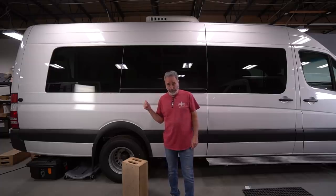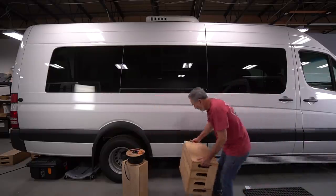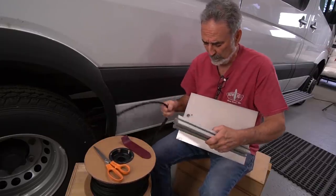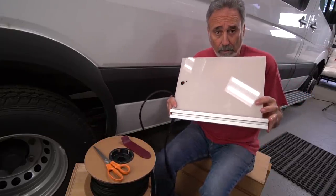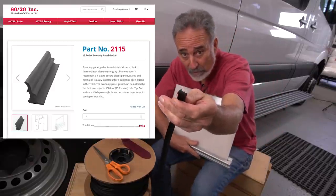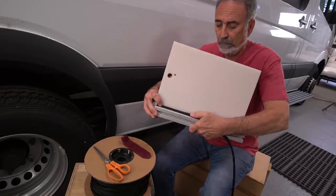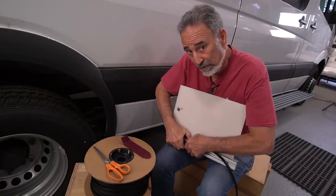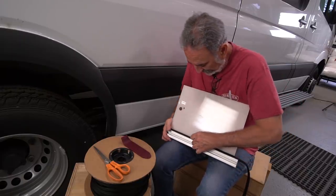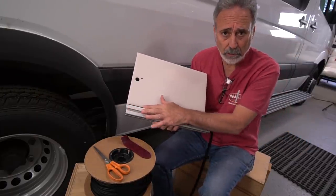I had a little brainstorm while I was working in the van. I was using a product from 8020. What this product does — it's used to prevent rattling when you put a panel inside the channel of the 8020. This is a barbed piece of weatherstrip. It's made specifically to tuck in alongside the panel and it stops the rattling. I'm using this in the van. All my Plexi is inset in the channels of the 8020, and I put this stuff on one side only and it does the job. It looks nice too — it gives it a nice finish.